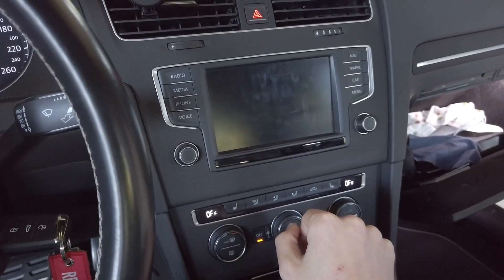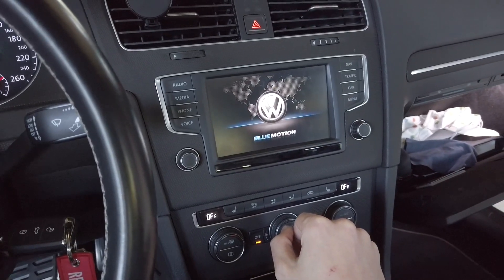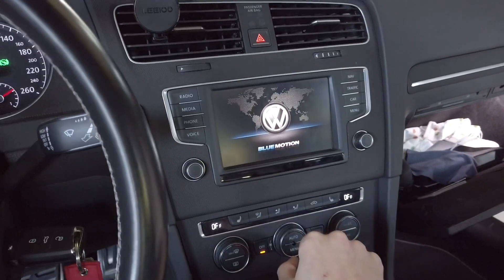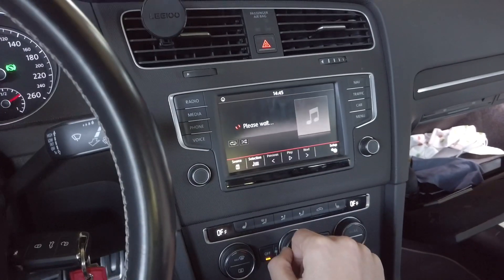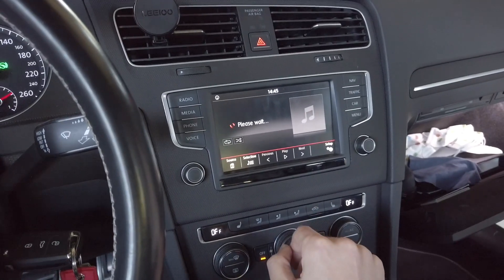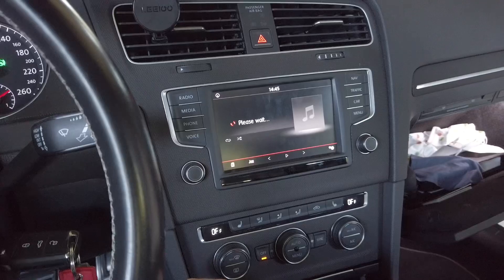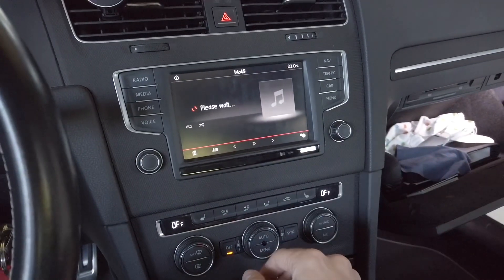In this car I have the old green engineering menu, which requires some additional actions before you install this toolbox. Of course, you need to have the green engineering menu enabled in your car, and you will need VCDS, OBD11, or some other similar tool to do that.